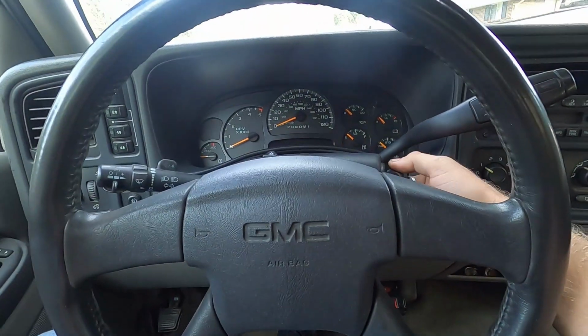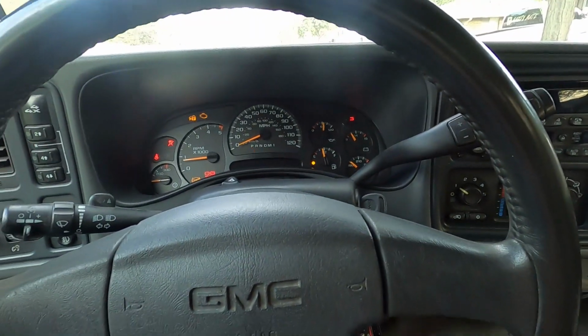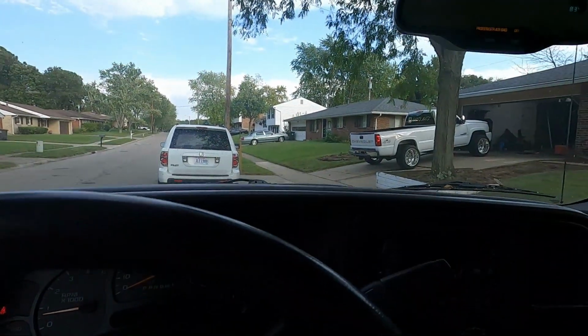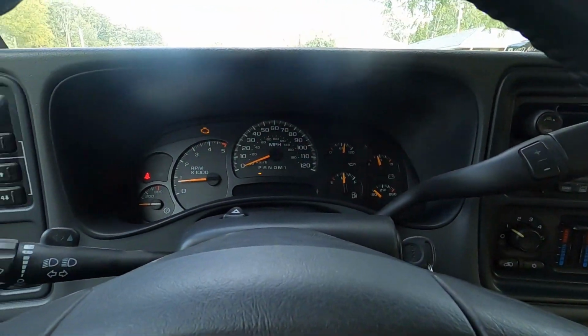All right, guys, first drive in two-wheel drive with the rear drive shaft. Here we go. Start her up. We're gonna get the engine code because I still need to figure out the turbo problem. Something about the turbo vane actuator. I put the one off of my single cab on this. It did not fix the problem, so I'm guessing either the vanes are stuck because this thing sat for a little while even before I bought the motor, the donor truck. It's really hot in here already.